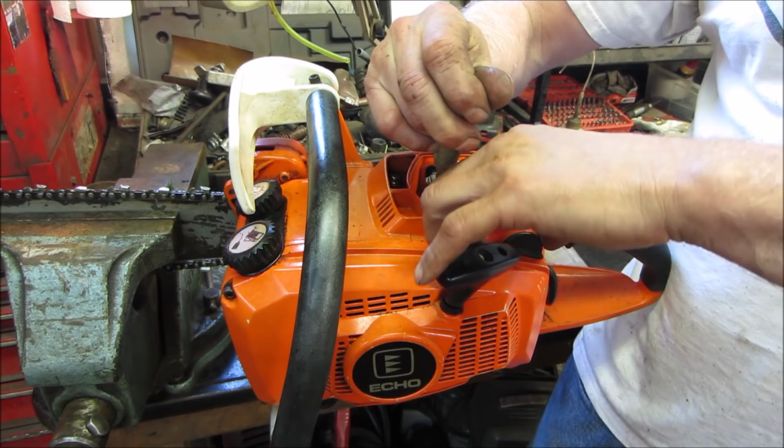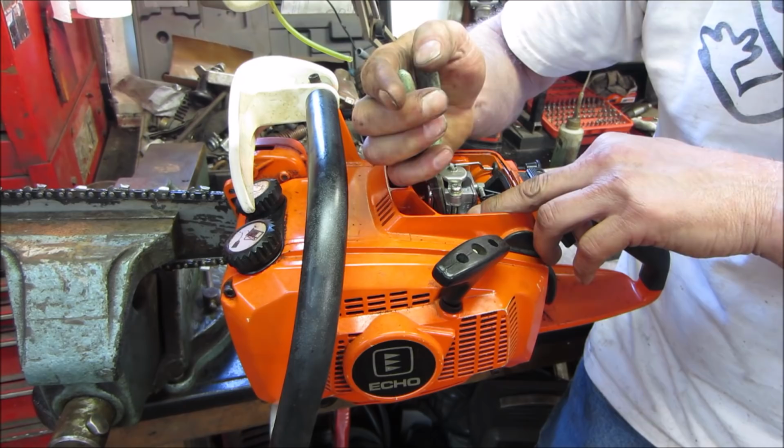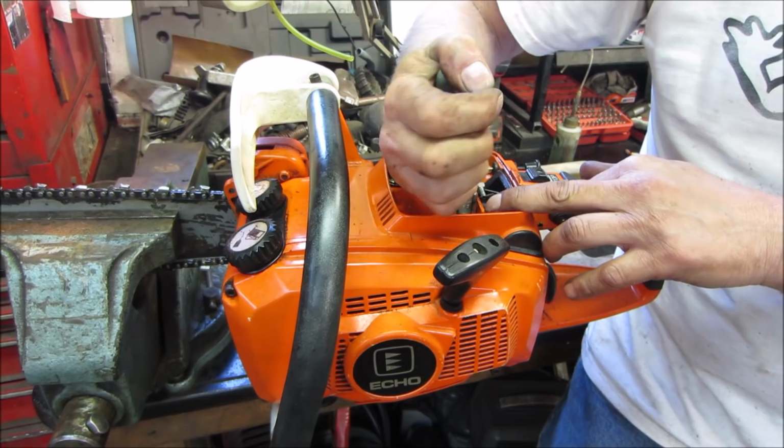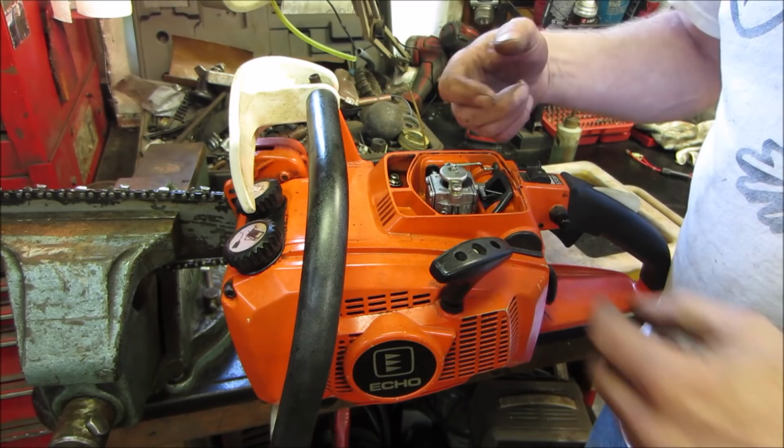Or it could have a crankcase leak. On a two-stroke, you use the bottom of the engine. The underside of the piston is like a sealed chamber. On both sides, if the seal leaks on any side of the crank, it sucks air through there and it leans the mix way out, essentially is what happens.